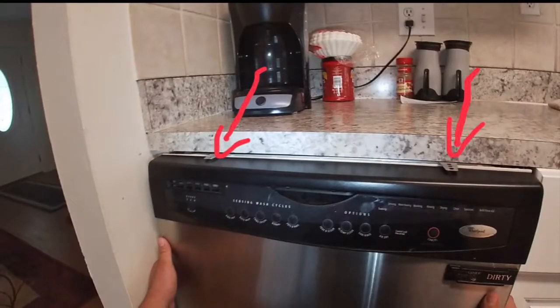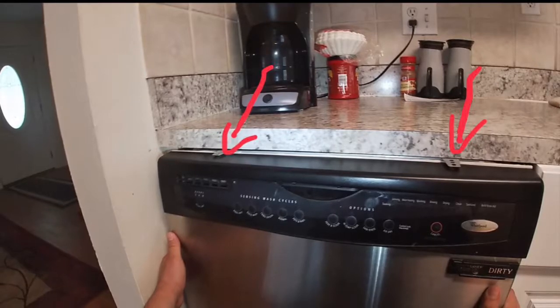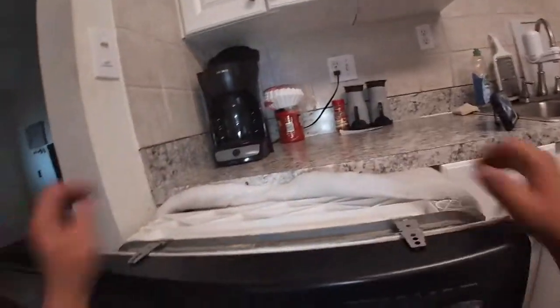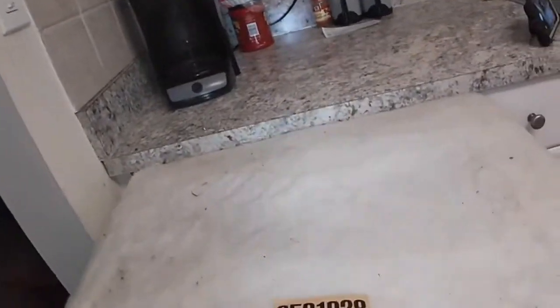Since I have a copper line, I really don't want to remove it from the dishwasher. You need to remove the two screws from the top of the dishwasher — sometimes those screws are on the side, with two screws on the top and two on the bottom. These screws are attached to the cabinet to hold the dishwasher in place. Also go ahead and loosen the front legs to bring the dishwasher down and wiggle it out.